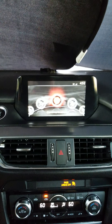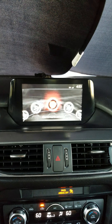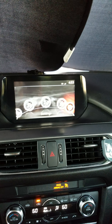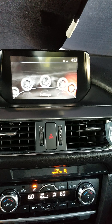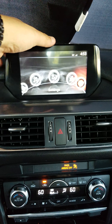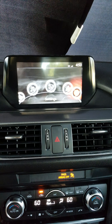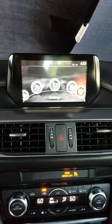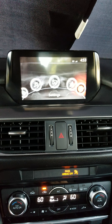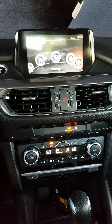After removing the start button panel, there's only one screw — actually a bolt — all the way in the back, probably about six or seven inches back. You'll see it; it's pretty obvious. Once you remove that bolt, there are a couple of clips, and you push the unit forward. The whole system will actually slide out at that point and you can do whatever you need to do, then reassemble in reverse.